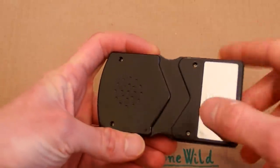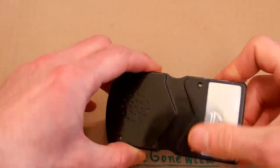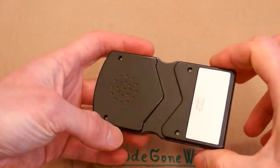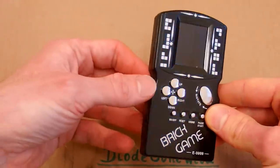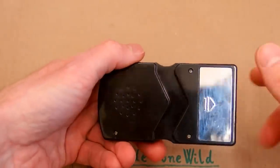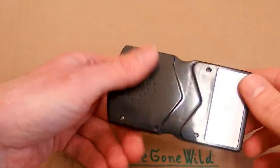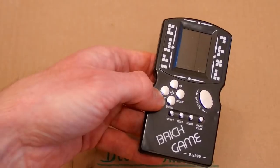It seems like this battery cover is actually not a battery cover — you can't even remove it and it's kind of metalized. This is probably too cheap for it to be real metal, but it's kind of metal-plated plastic. Those buttons as well are some chrome-plated plastic or something, and they work as electrodes. This is one electrode and those are the others, because the current basically has to go in a circle — you have to have two electrodes to give a shock.